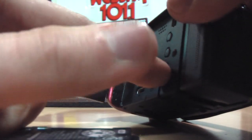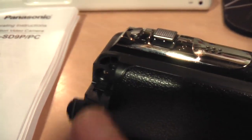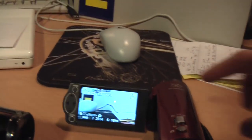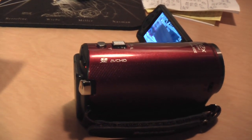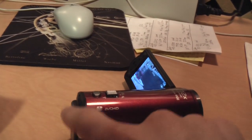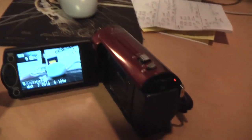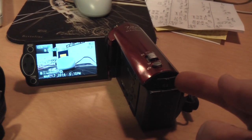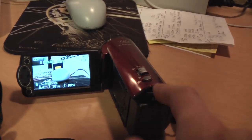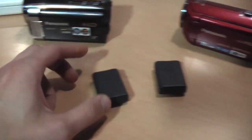It's clicked in — we hit the power button and the camcorder powers up. It's also useful keeping one of these older models on hand because they have the DC 5 volt input for charging, whereas the V110 can only charge through USB and has no DC input. Unfortunately, this also means it cannot run on AC power while recording, because the USB will only charge the battery and will not power the camcorder — so you're limited to battery life, and have to stop recording when it runs out.